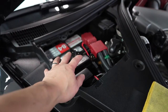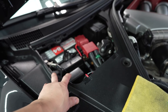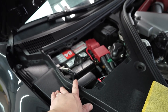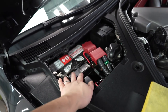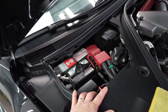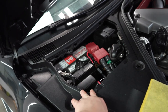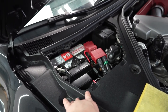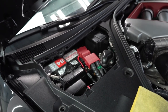What I've done in the past is connected my car to a trickle charger — a CTEK — and for some reason the battery still died, didn't last too long. So what I was told is to unplug the terminals from the battery and take the battery out. Instead of taking the battery out I'm just going to disconnect the two terminals and go from there, hopefully the battery will last a lot longer. So for winter storage, don't forget to disconnect the battery.